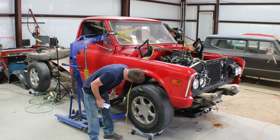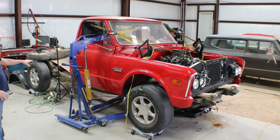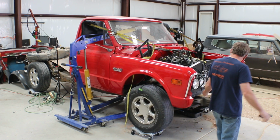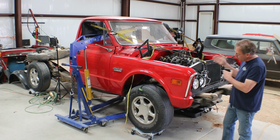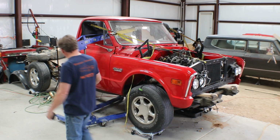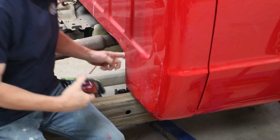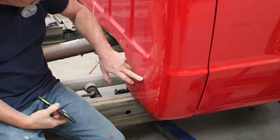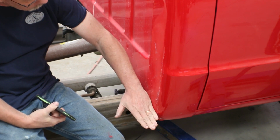Okay, so right now the body is about 6 inches above where I'd want it. Back here, we're just starting to sit on these 2x4s up here, and yet we're pretty close front to back. And the reason we're sitting up so high in the back right now is in this location: this is only one thickness of metal. There is a rib, and you can kind of see the divots here from the factory spot welds. There is a rib that goes out here to hold this up.